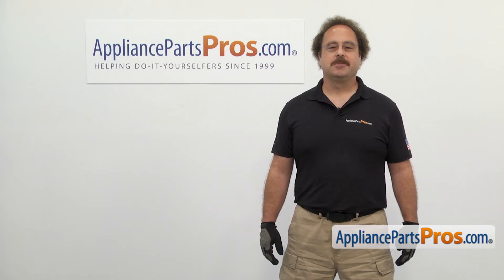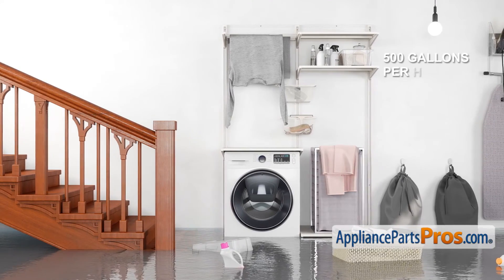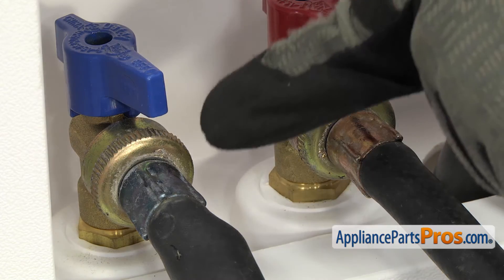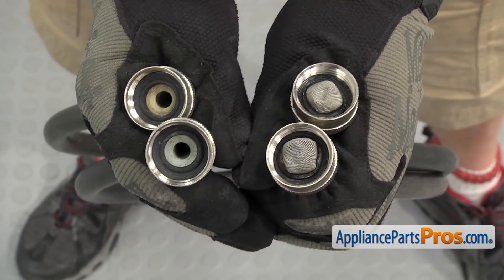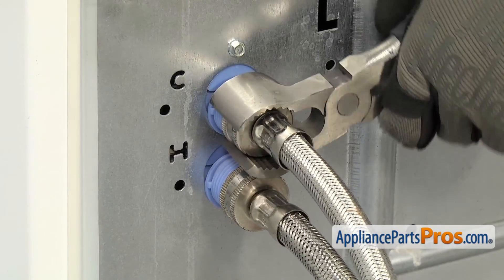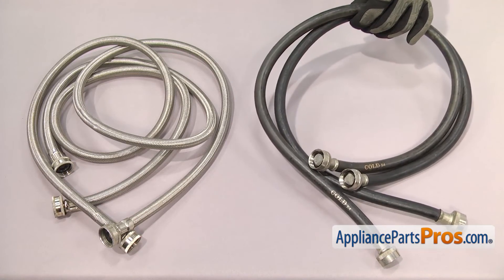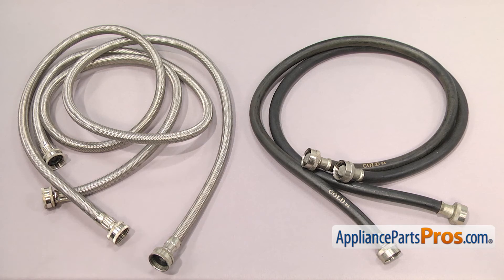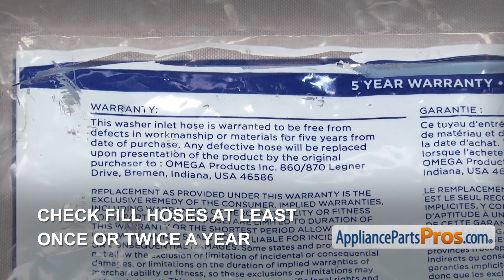Now here's that safety tip we promised you earlier. Washing machine fill hose inspection is often overlooked by most people. If your fill hose bursts, it can cause severe water damage to your home — a fill hose can flood your home with up to 500 gallons of water per hour, so it's important to inspect them regularly. Make sure to check the entire hose for any signs of bulging or leaking, and make sure the fittings aren't corroded. Then shut off the water and look at the washers and screens inside: if they're clogged, you can just clean them out, but if they're rusted or damaged, you'll need to replace them. When you reinstall them or put new ones on, make sure the hose fittings on each end are tight so you don't get any leaks. The most common hose types are rubber or braided stainless steel — if you want extra burst protection, it's recommended that you upgrade to the stainless steel type. Some newer systems even have an auto shutoff feature that shuts the water off if a leak or change in pressure is detected. Regardless of the hose type or the warranty it has, it's important to check them at least one to two times a year because they can fail at any time.